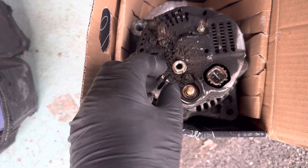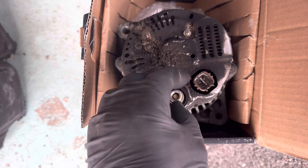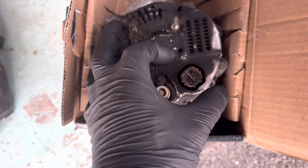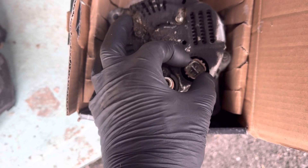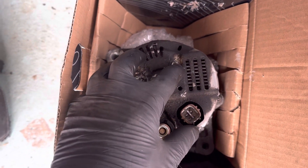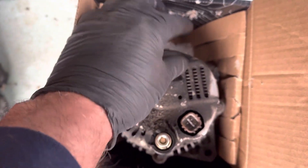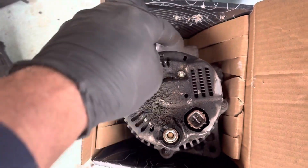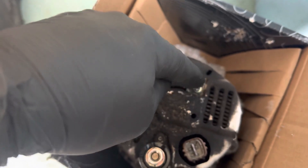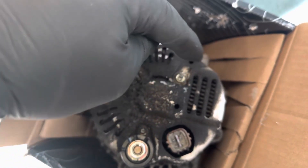There's a plug and a boot. Here's your little green plug — I used a screwdriver, but actually when I got the bracket I was able to get my hand in there and pinch the two sides and pull the plug out. This right here is also a little tiny screw, like an 8 millimeter, to get the harness bracket off that's holding the whole harness to the alternator.